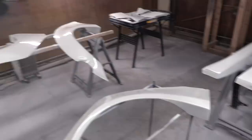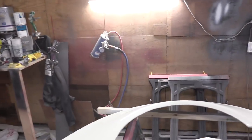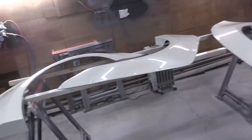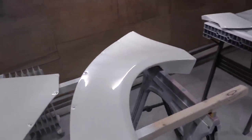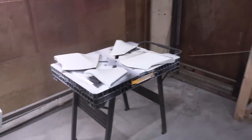It's the next morning. The panels dried up great. Everything worked out really well. Last night while we were painting, we had some weird issue with the airline — basically my air pressure would build and then drop repeatedly. It did get way below freezing last night outside, so a line running from the air compressor could have frozen with condensation or something was constricting the airflow. Luckily, because I was spraying one panel at a time, I could just spray one panel, and by the time I got through it I was running low on air pressure, then I'd wait for it to rebuild and go to the next. The other thing we changed: we put three layers of clear on all this stuff, which gives me a lot more material to wet sand and buff out to take it from a little bit of orange peel to 100% smooth. Overall, it looks fantastic. I'm really, really happy with it, and I'm happy we somehow managed to beat the weather conditions.